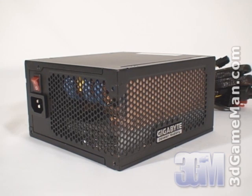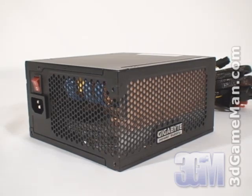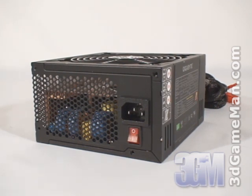There are a couple of important things to remember when selecting a power supply. The first is wattage — determine how much wattage you require based on the hardware you'll be installing. Generally speaking, a medium to high-end gaming rig would require a 500 to 700 watt power supply. If however you're going hardcore and have a multiple video card setup with lots of other hardware, select a power supply above 700 watts.